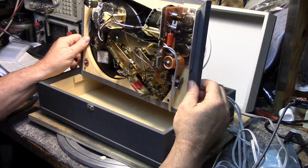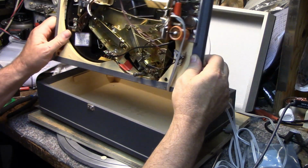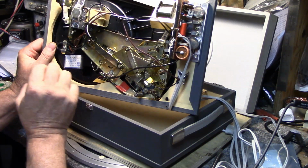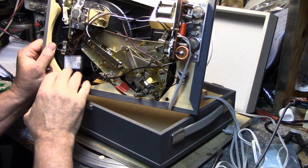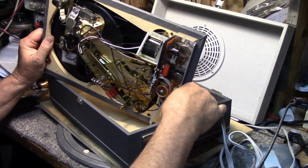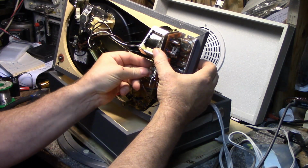Wow. Look at that. Okay, so we have a BSR turntable, C101, A25, PS2065/260. Runs at 220 volt, 50 hertz. There's no adjusting that for 60 hertz. Made in Germany. Here's a little fuse. Can't tell, it looks like it's intact. It's intact, yes.